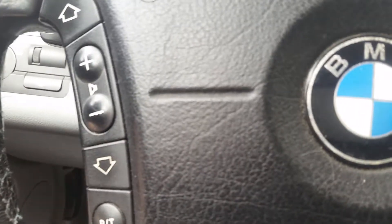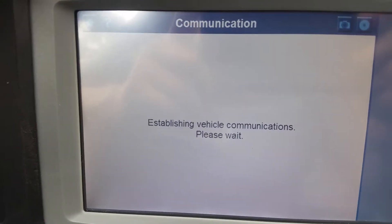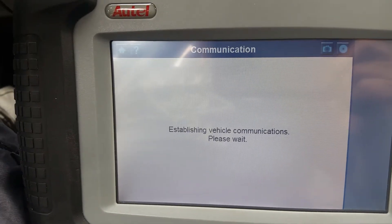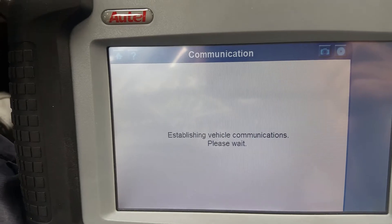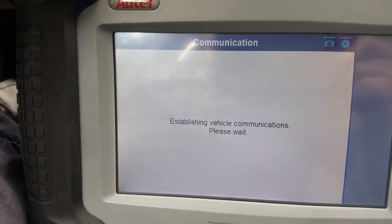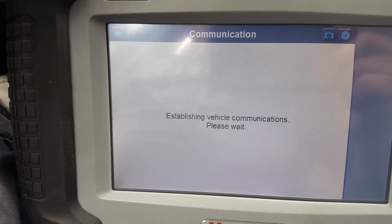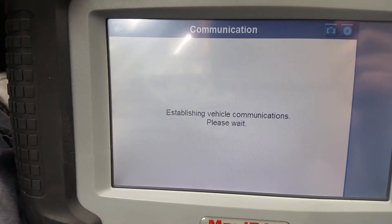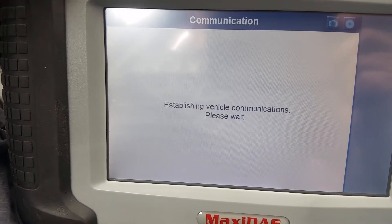You hear it humming. This is similar to what it did on a 98 Chevy Blazer - same thing, it goes through the same process. The only difference with that one is they want you to actually step on the brakes while you push the OK button, and it actually pulsates the brakes. Supposedly it bleeds out the air or vents it - where it bleeds to I have no idea. But the brake pedal on the 98 Blazer came up considerably, and this one on the BMW, same thing.